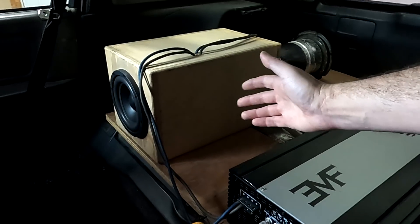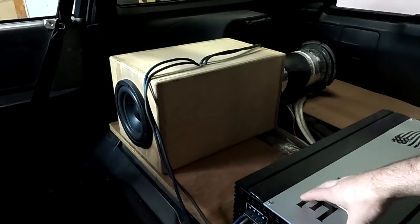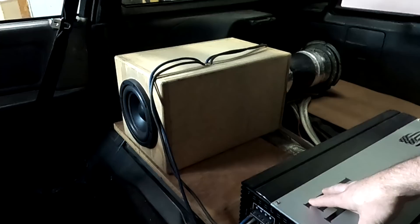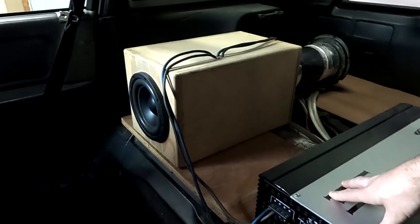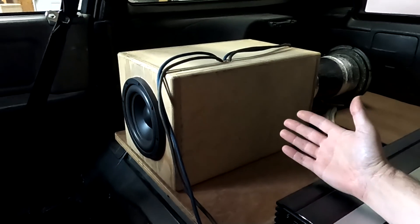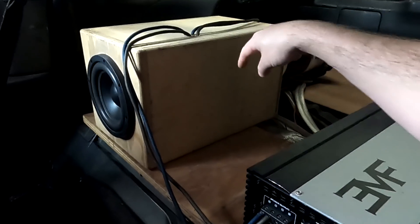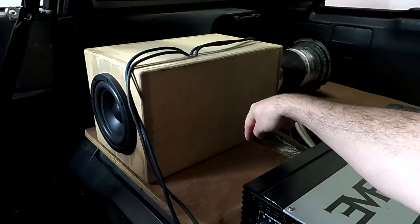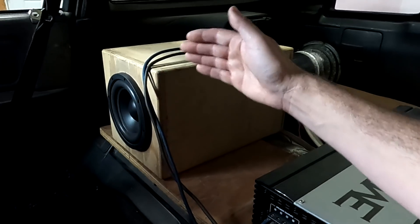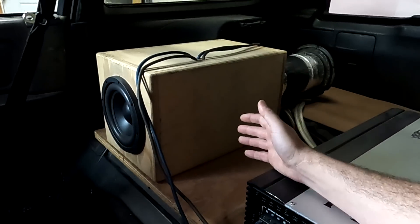Why wouldn't we scale to just do a two-sub box that's like this? Because then we have other factors on how the box is shaped, how it would load from doing two ports versus one port. But even though it's the same volume, there's different box characteristics that could change. So we're going to have two identical boxes — we can keep everything consistent with exactly one sub in one box, and exactly two subs in the same two boxes. So we're going to do some SPL metering.